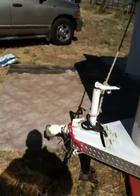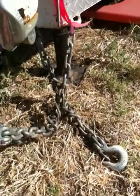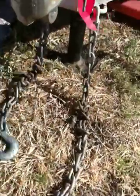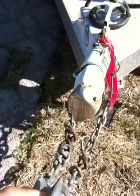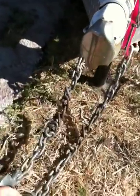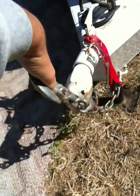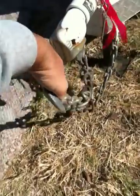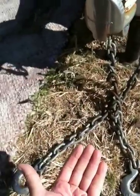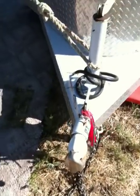As far as the chains — I see a lot of people hooking up their horse trailer and when you hook these safety chains up, it's recommended that you cross them. I see a lot of people hooking their chains where they're not crossed — one over here and one over here. What happens is if the trailer comes off, these safety chains are supposed to grab the trailer, but without crossing they won't support it. If you cross these chains when you hook them up, that cross will help support it and cradle the tongue if it falls. You should always cross your chains when you hook up.